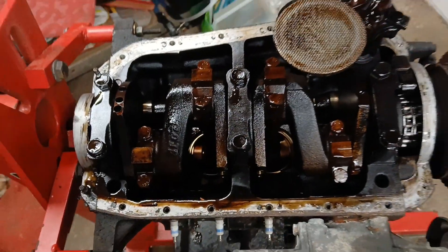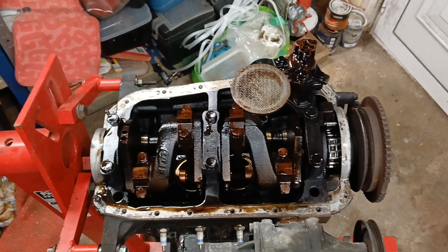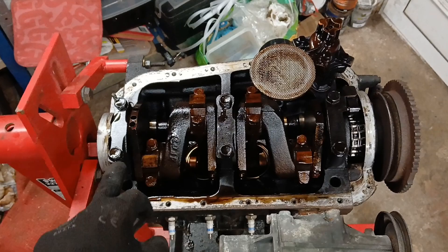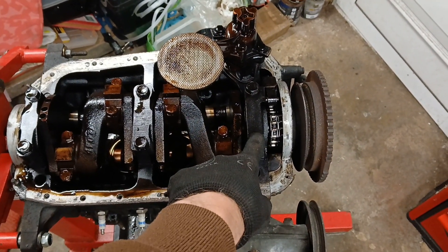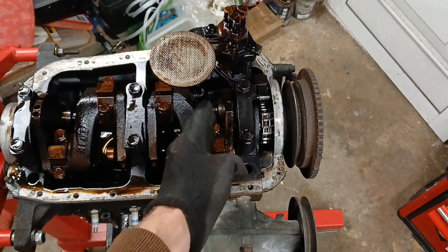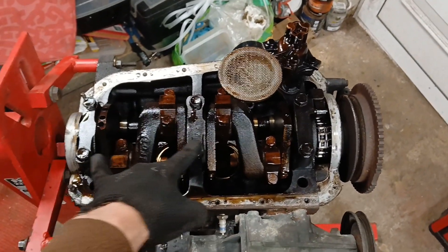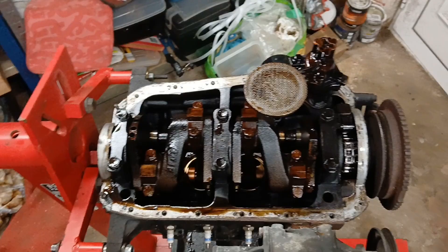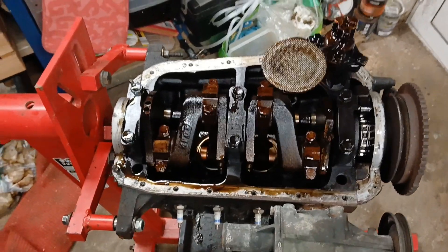You can see the cam down in the bottom of the engine — these ones with the pushrods have a little bit of a weird setup. There is one weakness on this, which my Italian man Claudio has told me worries him about me turboing one, and that's that the crank is only bolted in three places. On the normal 1.1 fire engine you have four main bearing girdles for the crank, and on these you only have three. I don't think that's going to matter — honestly, with the amount of power I'm going to try to put through one of these, I don't think it's going to cause me too many problems.